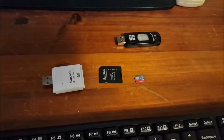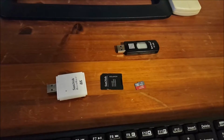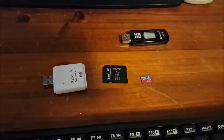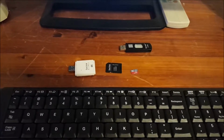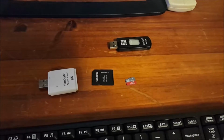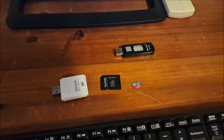There's another little app on there to play MP3 files. Again, it's like the radio, it's like the video. This unit's incredible. But I found, just from playing around, that an MPEG 4 file will play absolutely perfect on the head unit. So what I'd recommend, if you can get your video clips or your movies, and you can convert them to a 1080, whether it's P or I doesn't matter, but if you can convert it to a 1080 resolution in MPEG 4 format, they play perfectly. So earlier you saw my little AC/DC video clip. What I did was I sat there and I converted all my music video clips to an MPEG 4 format.